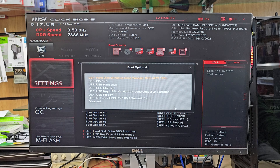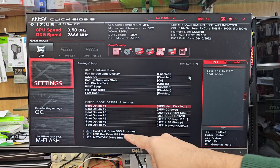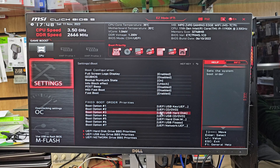From the Boot menu, we're going to choose the Boot Priority option. Number one has to be the USB. If your connected USB shows as boot number three, we need to move it to number one. Select your USB from the list, hit Enter, and it will move to the top of the list. Now everything is fine — we just need to save these changes and exit.